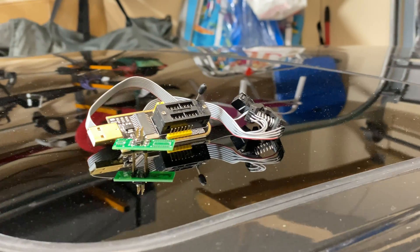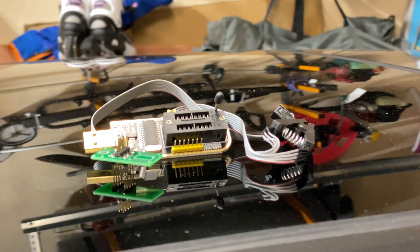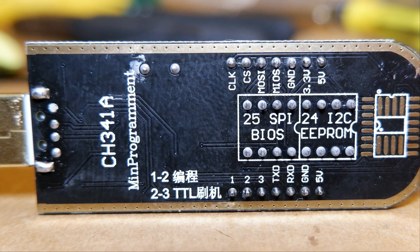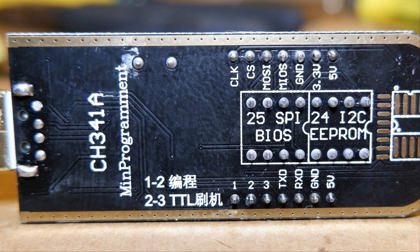So on today's video, what we're going to do is get inside this thing. I'm going to show you how to take it apart without breaking anything. Once we're inside, I'll show you how to prep the EEPROM chip and get the reader on there. Before we get started with that, I'll show you that $10 Amazon programmer I bought. You have to make some slight modifications to that programmer before you can actually use it on this gauge cluster or in any car environment, just because of the voltage. So I figured if you're geeky enough to attempt this, you should be able to make these modifications without any issues. What we're going to need is this $10 CH341A chip programmer that you can buy on Amazon.